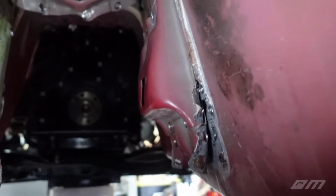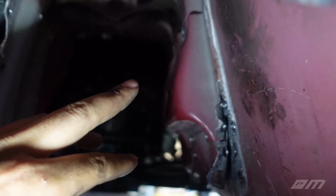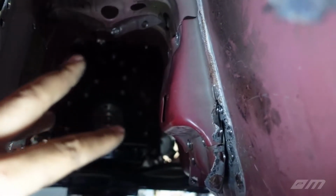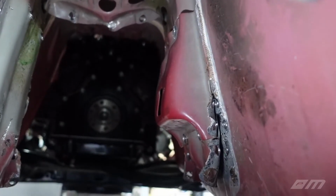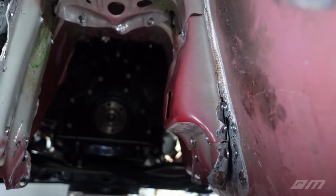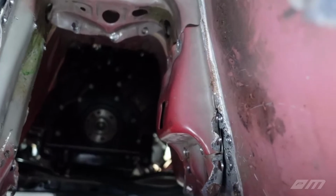Now we have to remove this first cover, which I think, Justin, didn't you say there's like 2 spot welds left on that? There's a few. There aren't many, but now we got a pretty good method of taking those out. That sander did help, but we went back to using that spot weld cutter, and it's working fantastic. We just have it on a much higher speed.